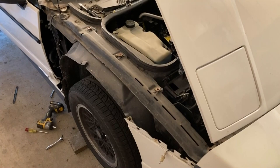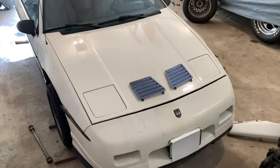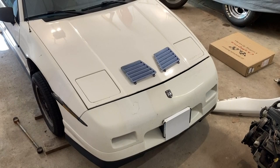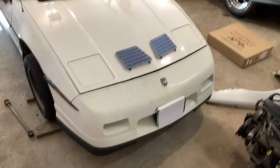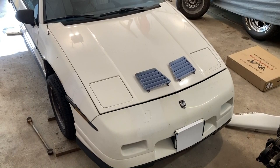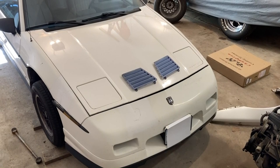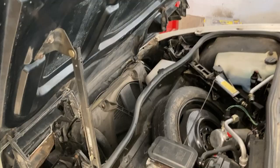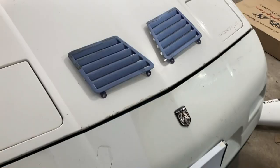The Trans-Am vents will go on the hood and they're going to look something like that. The car from the factory never went more than 115 miles an hour, and if it goes faster than that, air pressure builds up underneath the poorly designed bumper and pops the headlight covers up. Those covers could snap off, and at high enough speeds you could lose control as the front tires lift off the ground. These vents release the pressure building up under the hood, sucking the nose of the car back down. Putting a vent in the hood also helps pull more air through the radiator. These particular vents were actually showcased on a purple car that was on a magazine cover a few times.